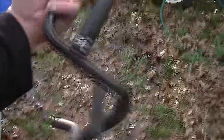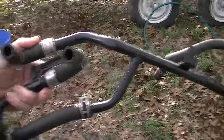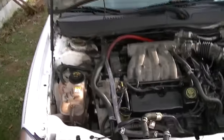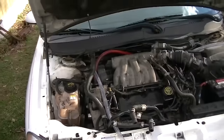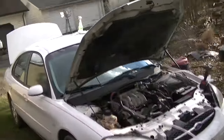One final thing: make sure you put the water hose on this connector piece and blow this out too, because a lot of times you can have a bunch of stuff in here. When you go to put water back in your engine you'll wonder where all that rusty debris came from. So blow this out, make sure it's nice and clean, and then you're on your way to a good heater. I'll be back later and give you an update on how the heater worked out.